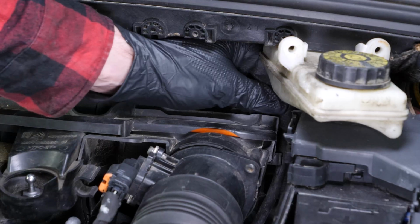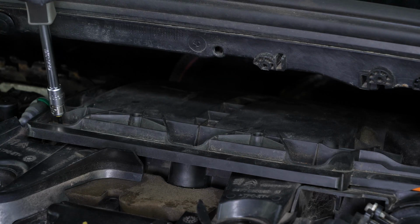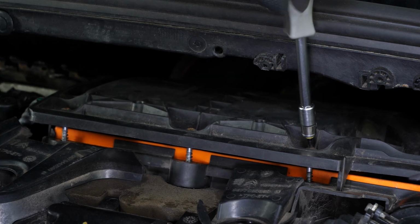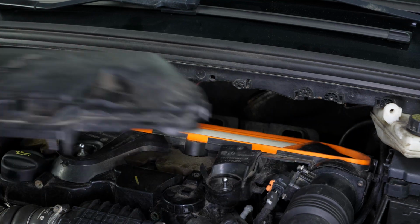Lift the airbox cover retaining latch. Using a socket wrench and a T25 Torx socket, completely unscrew the 3 screws from the air filter flange. Don't try to take them out. They stay in their housing even if they're not fixed in. Lift off the flange. To take it off, incline it slightly and pull towards you.